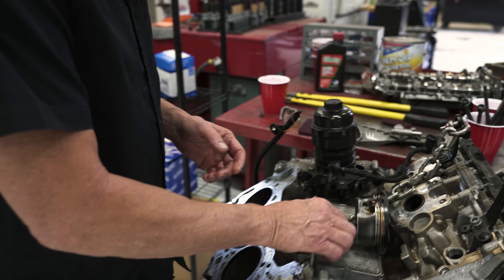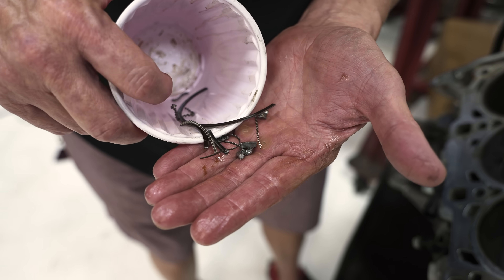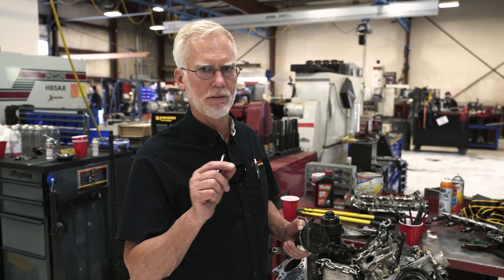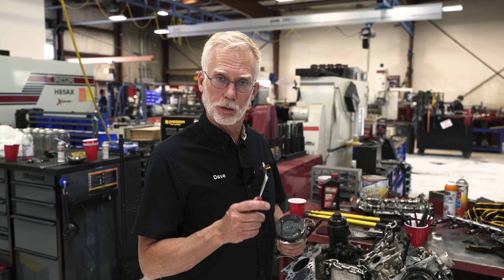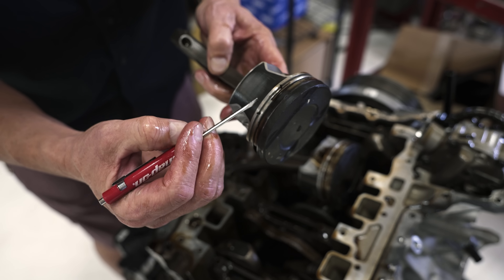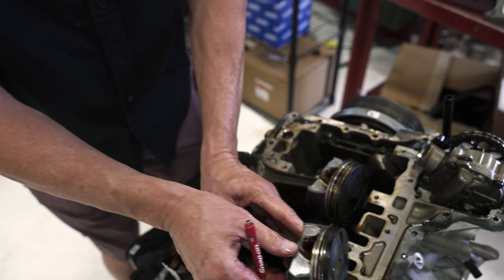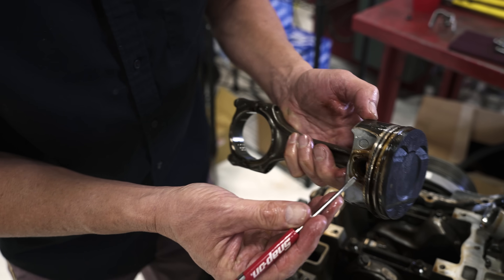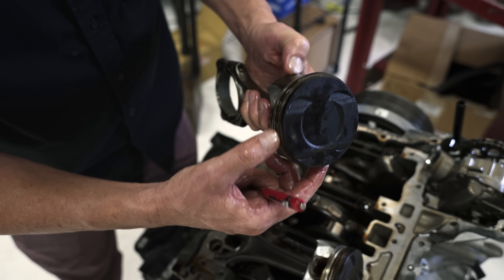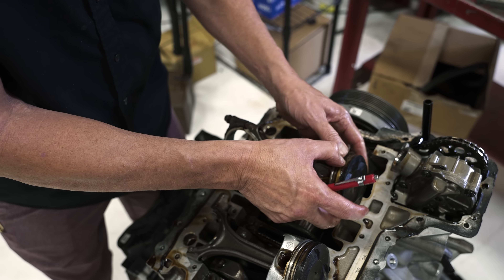Here's part of the stuff we found in the oil pan: the control ring, part of the second ring, pieces of the piston. This happens under low speed load normally when the engine is cold - like you're taking off and the oil is not warmed up, so the oil is thick. You want your API rating to have an SP in it. You want an SP rated oil. That oil is designed for direct injected engines. This bottom ring here is the oil ring. These holes are designed so that oil splash from the crank splashes up on the inside of the piston, allowing oil to get up on the cylinder wall. The second ring here is called the oil control ring.